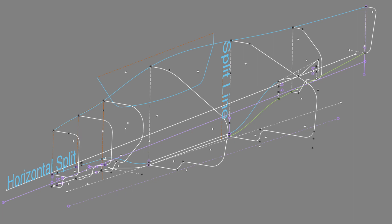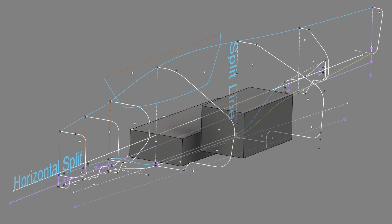I did play a lot with rough sketches and design bodies to represent all the internal components so I could play with the packaging. I started off with a side profile of the monocoque that roughly fits the components, then added ribs along the side that helped define the key parts of the monocoque's profile along its length. Then I began to design the mounting points for all of the components. Because I was packaging things like rockers and their mounts, I had to create additional ribs to further constrain the monocoque around those components and give sufficient space so that they could move through their entire range of motion. It's really just a step-by-step thing where I lofted the surface over the ribs and moved the suspension around to determine where I needed more or less control of the shape.